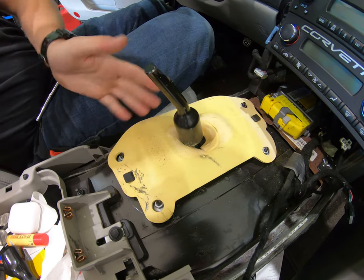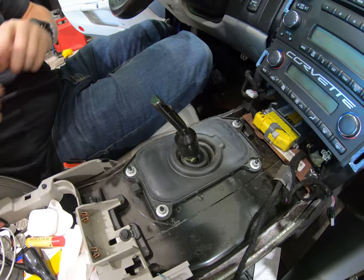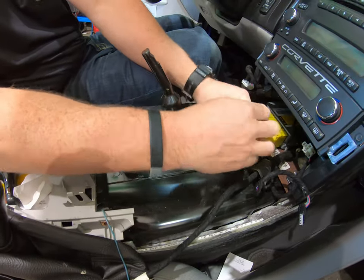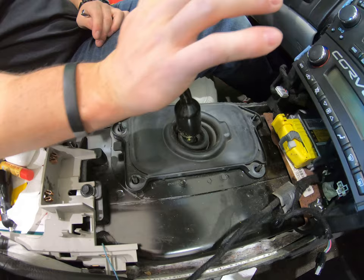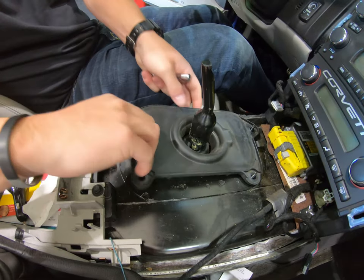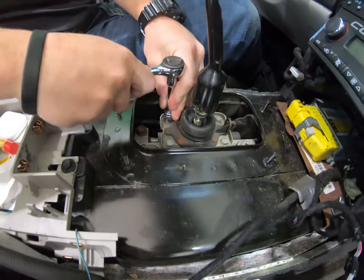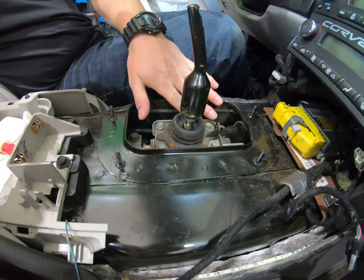The next step, we're actually going to remove the upper shifter. So once you have the console off, go ahead and remove this mat and get that out of the way. Now you're going to go ahead and remove these four 10 millimeter nuts. Once those four are off — crucial, don't forget — put it back in neutral. It has to be in neutral. Now you're going to be able to remove this. It might be kind of adhered down, just pop it loose and take that off. Now you're going to go ahead and remove four 10 millimeter bolts that hold the upper shifter plate in.